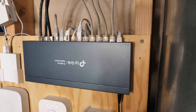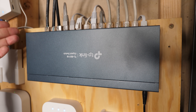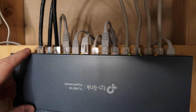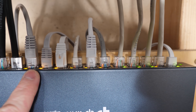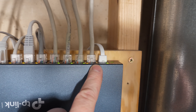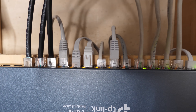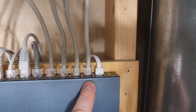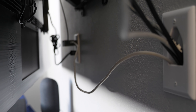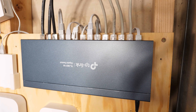It has been a few days since I installed my new switch. I did some rearranging — the way I had this oriented didn't actually fit on the screw holes properly, and I wish there were screws that came in the box but there aren't. So now I have everything plugged in up here. You'll see at the top all of the things that are connected are flashing a color — the ones flashing orange are 100 megabits per second or less, and then the green ones are getting a gigabit per second connection. Down here some of them are not flashing because the other end has nothing plugged in — this is just for future expansion. I have some rooms where I have ethernet cables but nothing is currently plugged in on that side. Over here on the other end I have a Chromecast Ultra plugged in, and it looks like it's not getting a gigabit connection. I plugged in my computer over there and it turned green, showing it was working properly and there's nothing wrong with the cable. So far all of my different devices plugged directly in are working great.